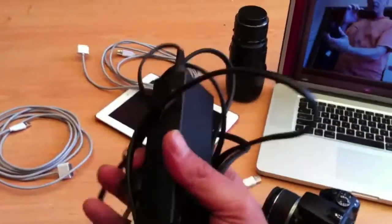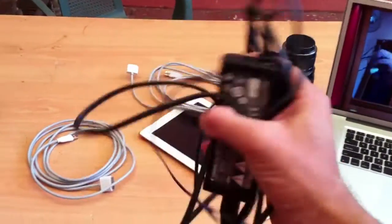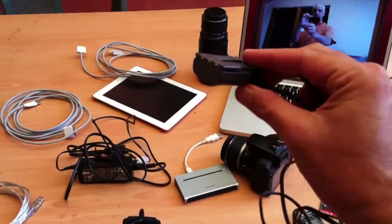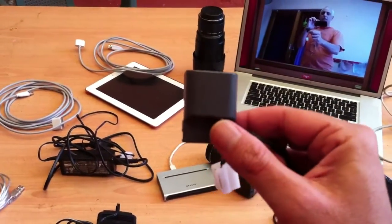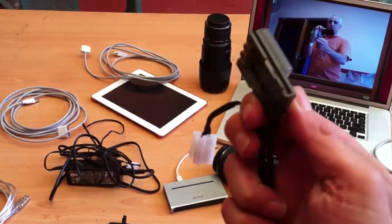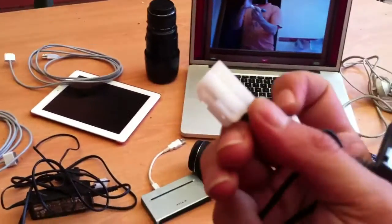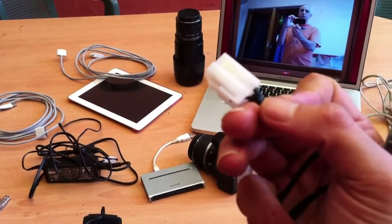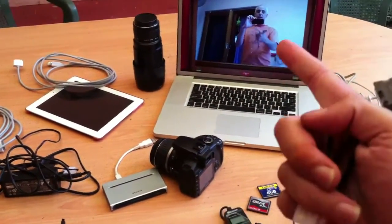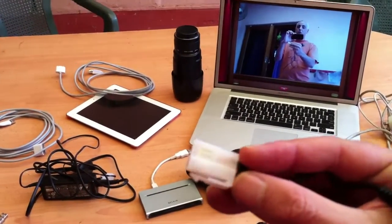This thing here is a Canon AC-to-DC adapter for your digital camera. What that does is, through this connector here, lets you replace the battery with live power. So there's no swapping batteries out and fiddling about — it's just constant power. I've had this modified. One issue is that when you turn the car off, you don't want to be drawing 150 watts from the car battery. The camera obviously doesn't take that, and the laptop has its own battery, so it doesn't really need to be powered by the car all of the time.